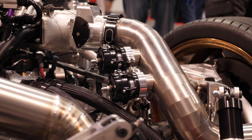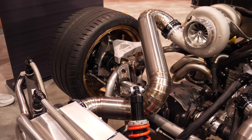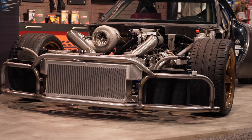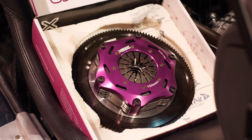I noticed a unique take on oil filtration on this car. Often when looking for bearing material in the oil you cut the filter open, which is messy and time consuming. I purchased a Clearview oil filter — it's a stainless steel mesh screen that catches anything larger than 60 microns. As soon as the oil exits the dry sump pan through the scavenging pump, before it makes it into the tank, it passes through this screen. You can then force air through it and visually see what's sitting on that screen — a quicker way of catching a potential bearing problem before the inevitable outcome.